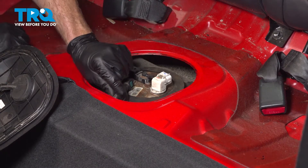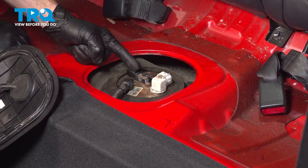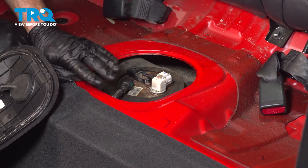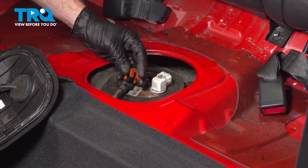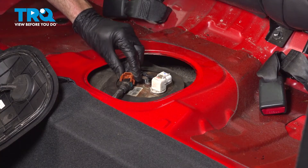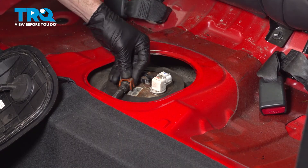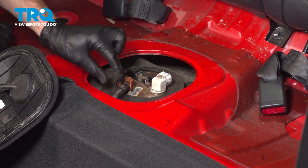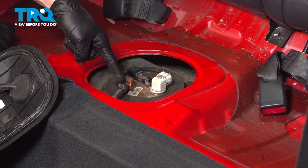There was an audible click — give it a tug. At this point, it should be able to move back and forth a tiny bit, but it should not be able to slide off. If it can slide off, there's an issue and you're going to have a fuel leak. Once you've confirmed it's properly secured, continue on with the orange locking tab. Come in at an angle and slide it down into position by squeezing out on those tabs — it should wrap around and lock into proper position. Triple check by giving it a little tug to make sure it's properly secured.